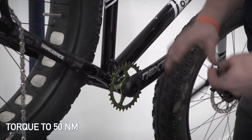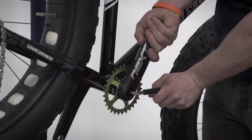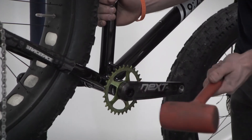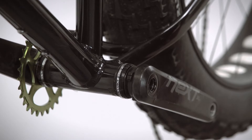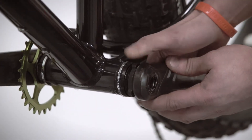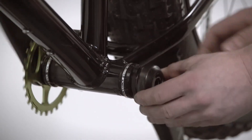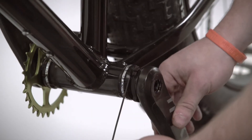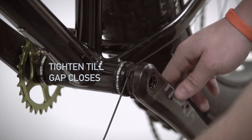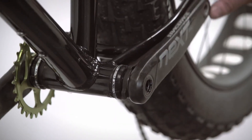Again, 50 Nm is the correct crank bolt torque. Once that's tightened down all the way, push the drive side crank all the way in and use a mallet if you need to. The last stage of this process is to preload our new BB: take the lock ring and thread it with your fingers until it snugs down and preloads the BB bearings — finger tight is all that's required. Then take our 2mm hex key, locate the split in the preloader ring and tighten that up until the gap closes — no further than that. There you go: a fully installed, converted cinch crankset ready to go on your new bike.